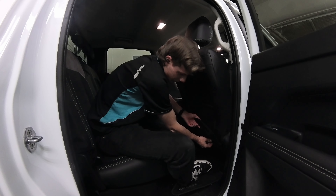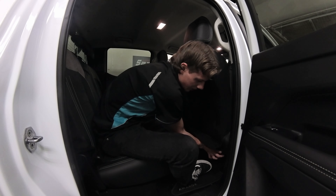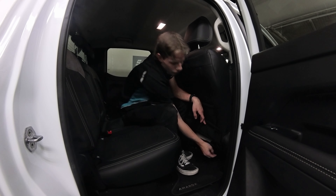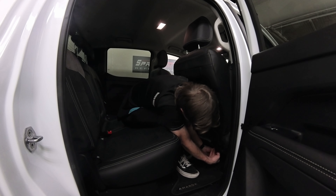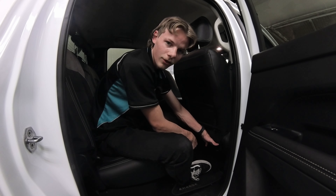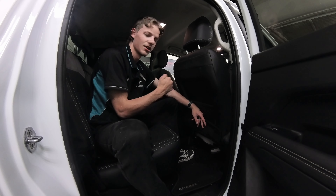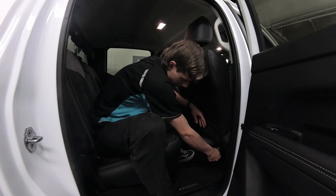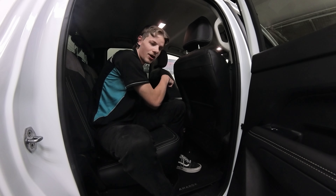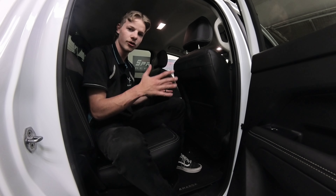Now go to the back of the seat. Lift the carpet flap up and pull through the piece you pushed from the front. Feel for the two velcro straps and pull them nice and tight to get some strength on that base. You should also be able to grab the two long straps that came from the front — attach the short strap you pushed through at the beginning to that long one, nice and tight. For the side piece, pull it through vertically with the velcro facing inward toward the passenger, then wrap it straight onto the base and velcro it to the little piece of carpet underneath. Pull the strap between the center console and seat to line everything up tight, but don't attach it yet.